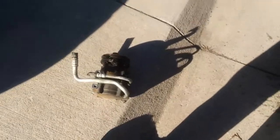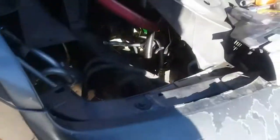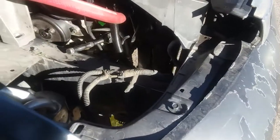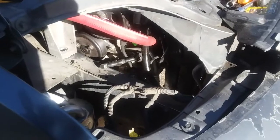2007 Ford Focus — just got a new AC compressor from the junkyard and taking out the old one. One thing I found to be a whole heck of a lot easier: take the passenger side headlight out and you get easy access.